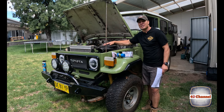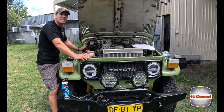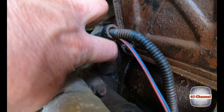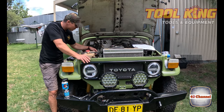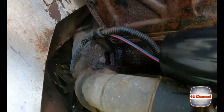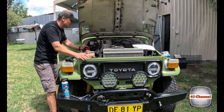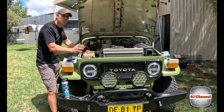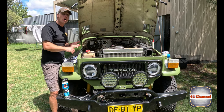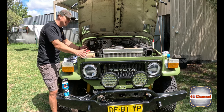So the first thing I've done is checked my timing to make sure it's okay — it was a little bit out. To access your timing, it's on the back of the flywheel, so undo your little cap with the 10 mil screw and expose that timing needle. Timing guns are pretty cheap — you can pick them up online. Get your timing right before making any changes to the ignition. The next important thing is to go through the instructions and check your voltage and ohms to make sure they're all within spec, otherwise you can quickly damage the electronic ignition.